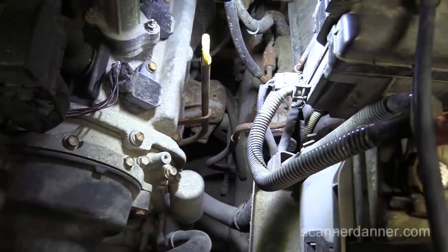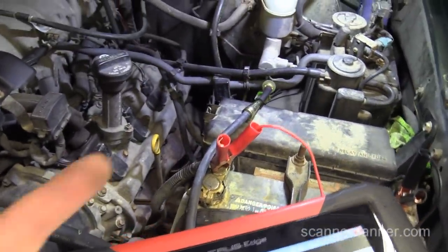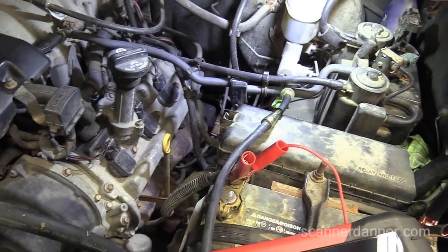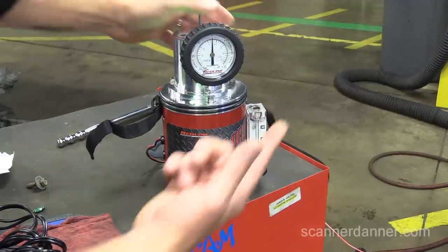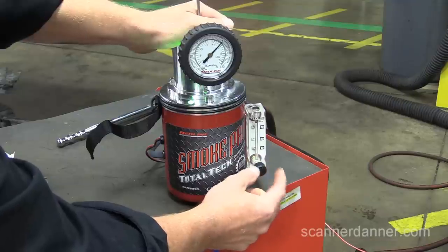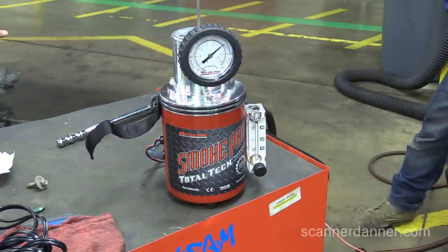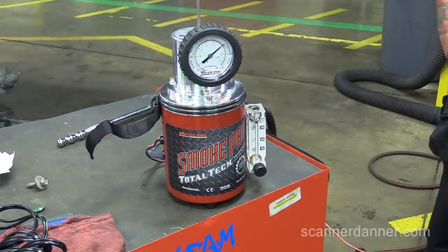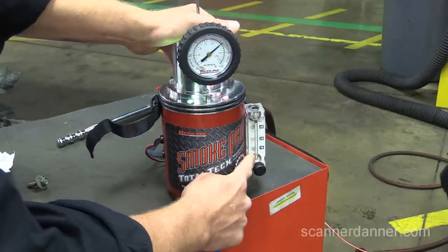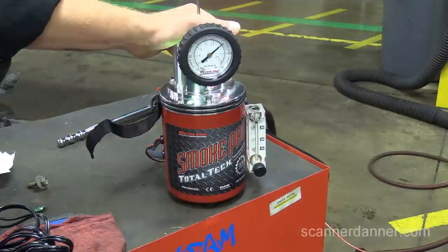Whether we can close the vent with the scan tool is still up for debate, but what I generally do with a smoke test is put smoke in through our service port and see where it's coming from. If it's coming out of the frame, I know that's the vent. We have it hooked up to the battery and the airline connected. Open it up to full system air, hit the button — it goes through a five-minute smoke cycle — then we start looking for leaks. I want to see where the smoke's coming from first, since I don't know where the vent is yet.